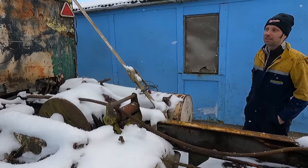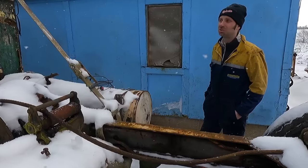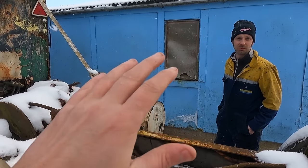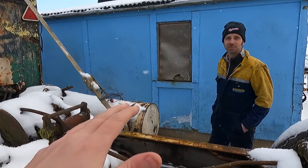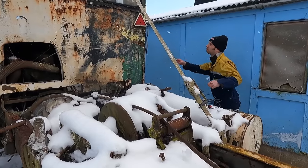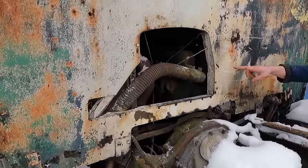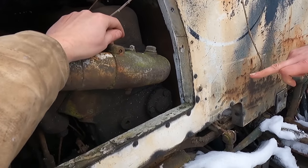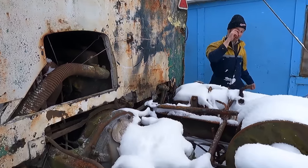On these, there's no glow plugs. Nope. There's no heater in the manifold or anything like that. There's no cold start button. However, to the absolute horror of all the safe space people, what did they fit these with from the factory? Ether. They had an ether system mounted on the holes here. You can see that plug there, on the top of the manifold. There's a lever just above it with a butterfly valve. You pull a lever in the cab, that would shut that valve, and then dump a load of ether into that intake. Factory fit.